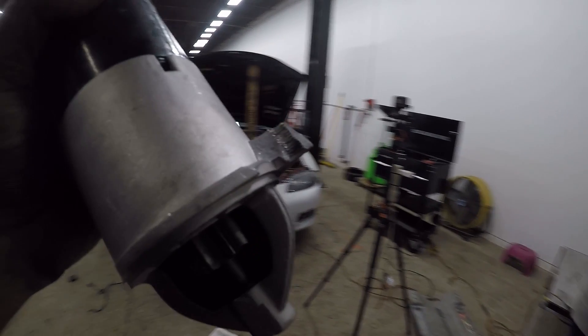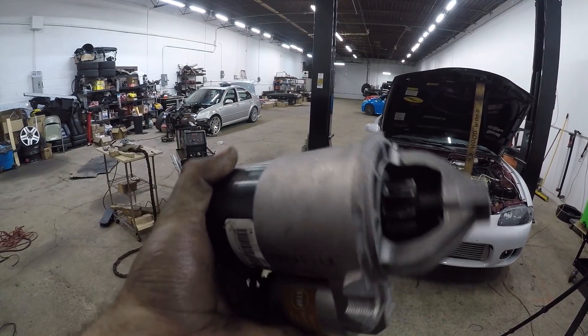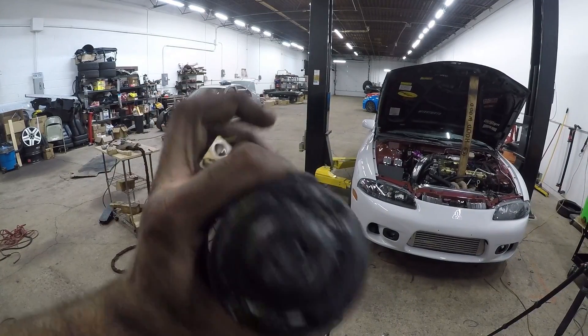I got the alternator all on there and it's all hooked up. The only thing I gotta do is throw that wire I ran through the car into the trunk, and now I just gotta put the new starter in. Izzy was kind enough to take the old one off for me. Originally I thought just the solenoid stopped working — the starter wasn't clicking, just spinning. Here's a close-up of the starter: there's an ear broken off on one side, and the same thing on the other side — that's why it wasn't working. I literally cranked that one maybe four or five times and that's what happened. Fingers crossed for this next one.